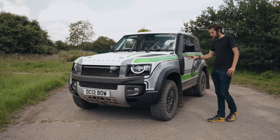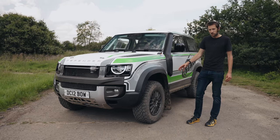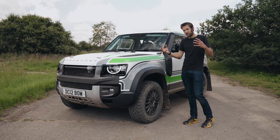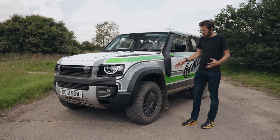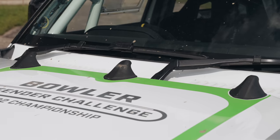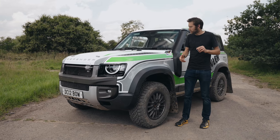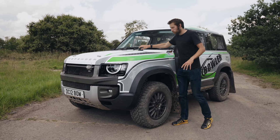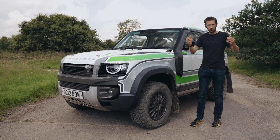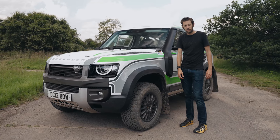Moving down the side, new wheels and obviously new tyres as well. These are 18-inch wheels, and whereas the standard 18-inch wheels are rated up to about a tonne in terms of load, these are rated at 1.25 tonnes. These sort of remind me of the vortex generators on that Evo 10 that they did, but these are washer fluid nozzles — just as you're coming through mud or dust or whatever, a massive squirt of washer fluid onto the screen to clear it.